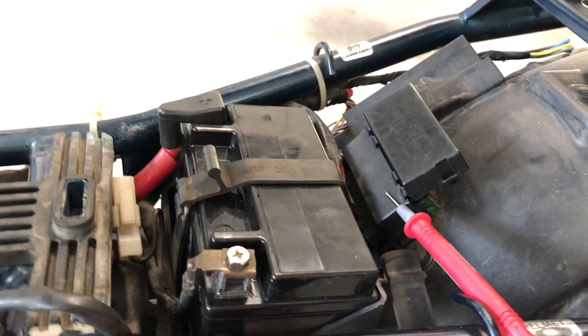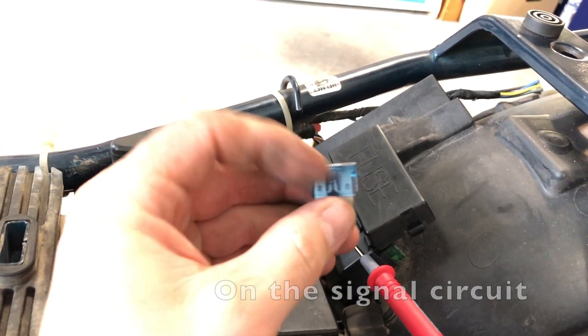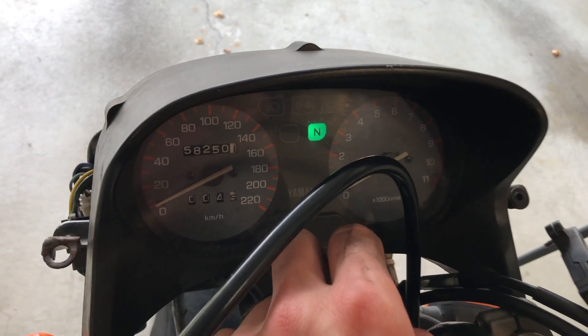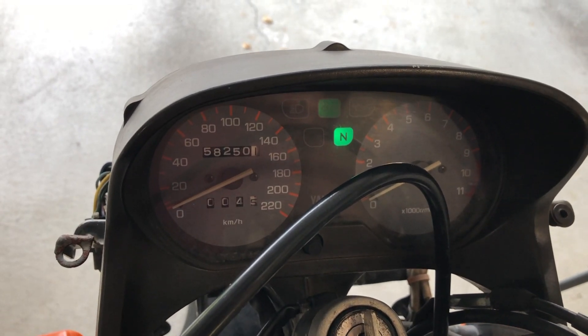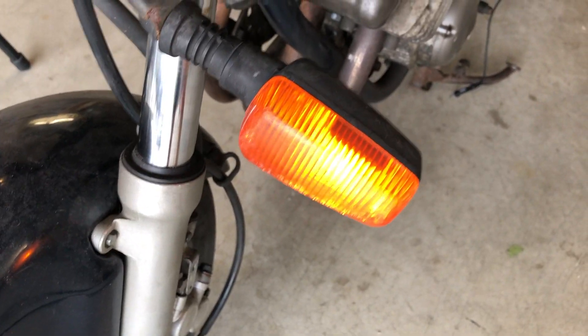The progress I've discovered poking around is that I had a blown fuse — yeah, can't believe I didn't pick this up sooner. Now that I fixed the broken fuse, I have a neutral light as you can see there, and when I hit the button I also get a turn signal, and you can also hear the flasher relay clicking.